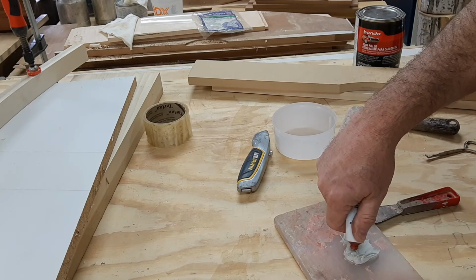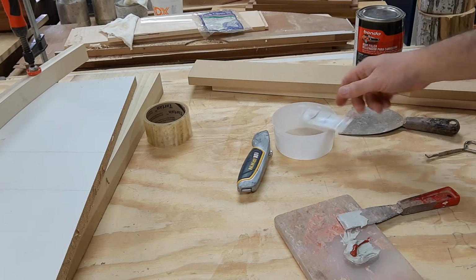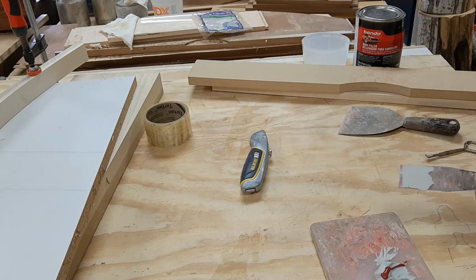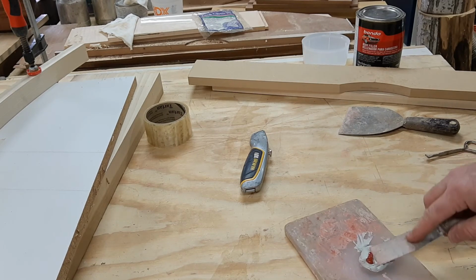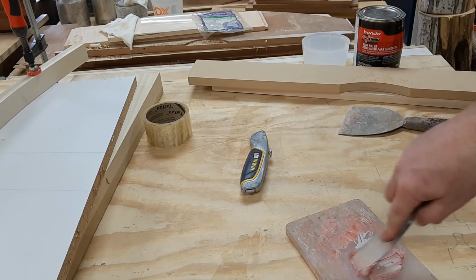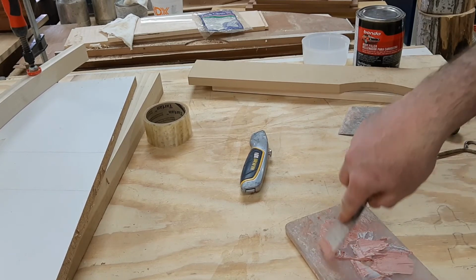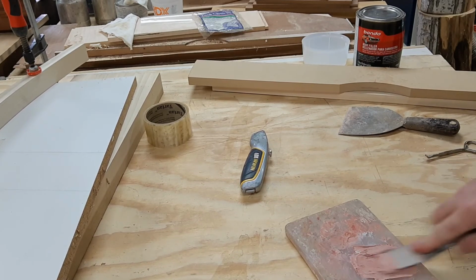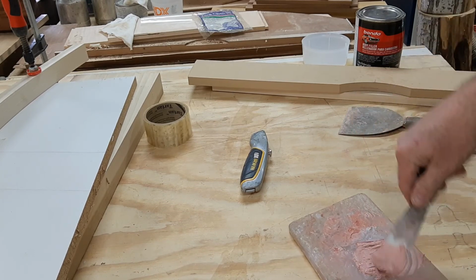I did an earlier video talking about how much of this goes to the hardener to the Bondo. And the correct answer is about that much. If you use too much hardener, the stuff just starts to set too fast. If it's too little, then it takes longer to cure. Ultimately, once you start using one specific hardener and whatever the base material here is of the body filler, you'll start to recognize this a little bit more succinctly by color as being too much or too little. And you kind of just get a sense of it.